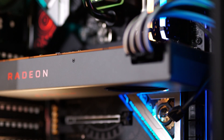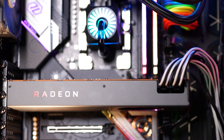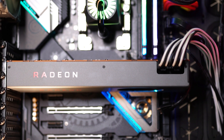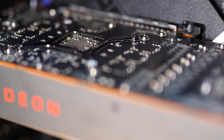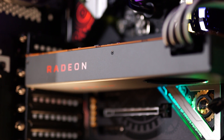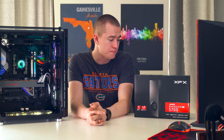After everything was said and done, we tested all of the registry edits. The best setup I could get was 1,900 megahertz on the core clock at a 40% power limit — I didn't need to go all the way up to 50%. We peaked at something like 220 watts peak power draw. So it's not really adding that much power, but it's only adding 50 additional megahertz. What the card was actually running at was about 1,835 megahertz. It doesn't seem like there's much benefit to unlocking the 5700. It could be a driver update from AMD, the even more power table could need more manipulation, or it could just be something I'm missing. If you've played with the 5700 with the power play tables, let me know down in the comments.